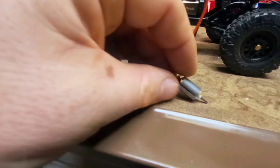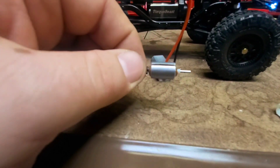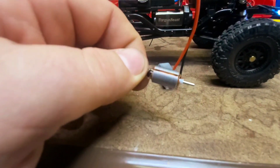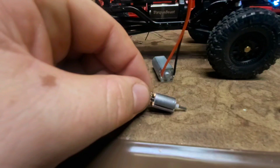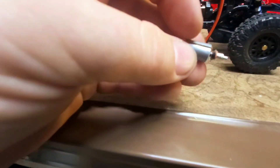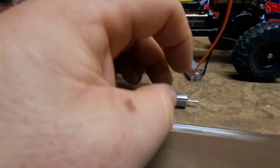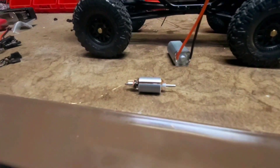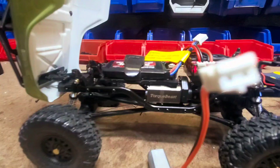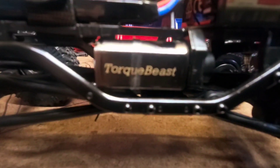The windings and armature on this one — the armature is about the same. The old windings I think were 67, 68, or 65; I'd have to go back and look at what I had spec'd out last time. They were a little bit slower than stock, so this time I went with a 56 turn winding. It's actually a little bit faster than stock and still crawls amazingly. That new Torque Beast motor also has 'Torque Beast' laser scribed on it.